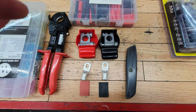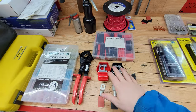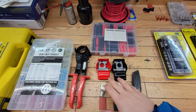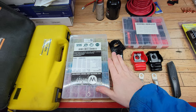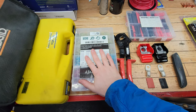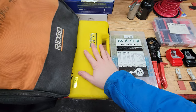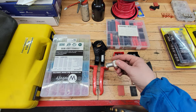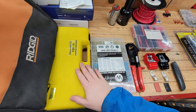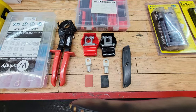A couple of things you're going to need for this project: obviously the military style battery terminals themselves, some two-gauge lugs for the positive and negative that go to the starter and the engine block, something to cut the large wires, marine grade connectors for the smaller factory wires, marine grade heat shrink, and a hydraulic crimping tool. Whenever you're using lugs like this, the best way to attach them is the crimping method. I'll link everything I use for this project in the description box below.